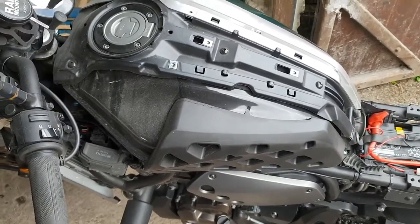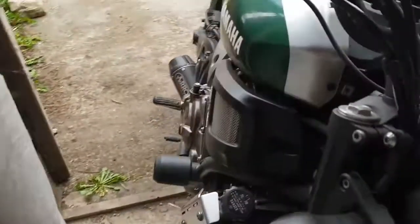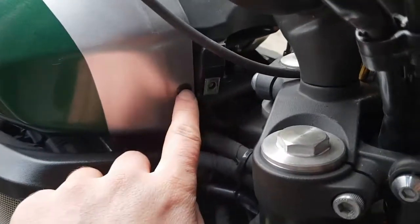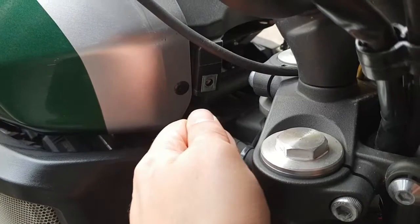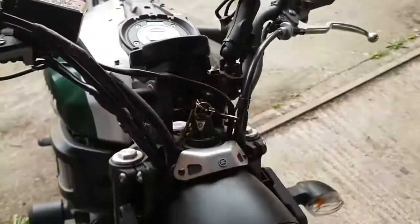When you've done that the side cover comes off pretty easily. One thing to note: at the front of each side panel there is a small plastic clip. You release these by getting something small — like a small allen key — and poking it in the middle until it pops, and then it should lift away.